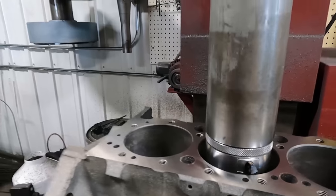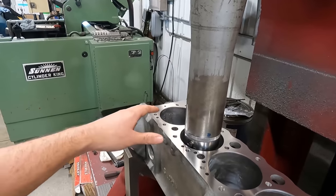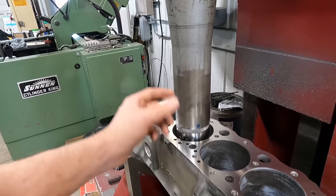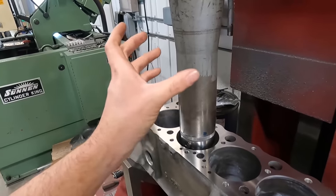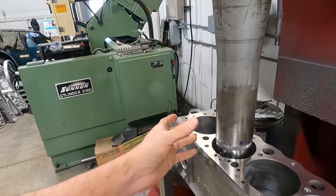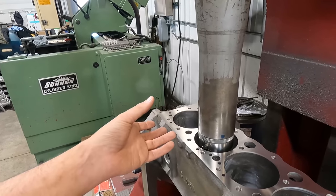I'm going to cut down — I set the cutter to 20, even though we're going 30 over on this block, because I want to test out the new cutter. So I set it to 20, I'm going to cut down, then get the bore gauge out and measure it to make sure it's cutting like I think it should be. And then I'm going to go to 30 after I'm confident that the new cutter is working like I think it is.